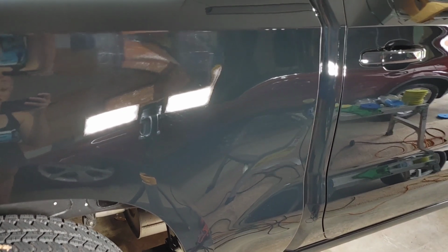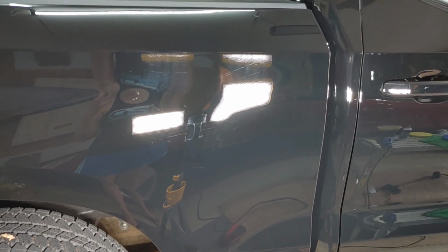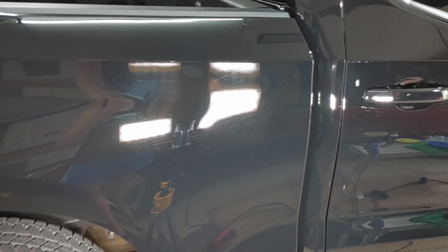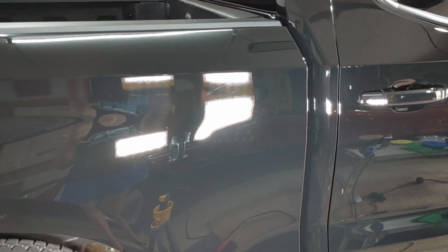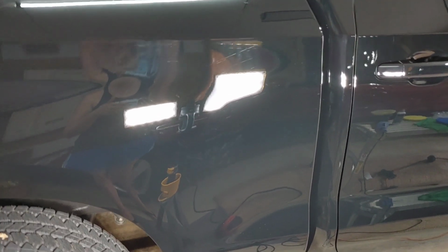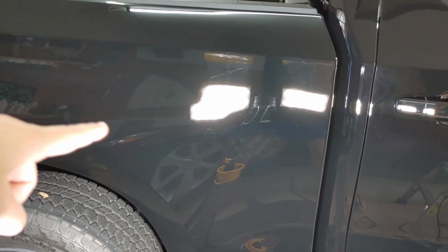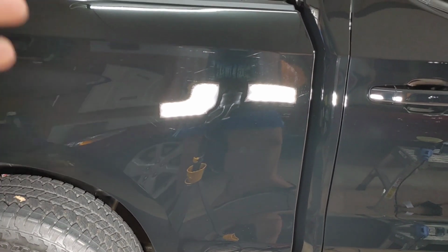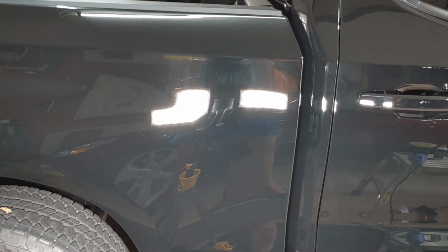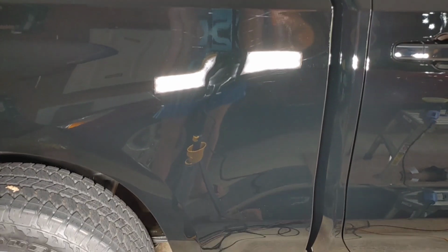Is it going to work? So I probably could use their medium compound in this moment, but because I don't want to run the risk of cutting too aggressively and not finishing down well, I am going to switch gears a little bit. I was using the G9, again, not a very aggressive polisher. I was using it around speed 4.5. And the Jescar polishing pad, again, beautiful job of finishing down well.